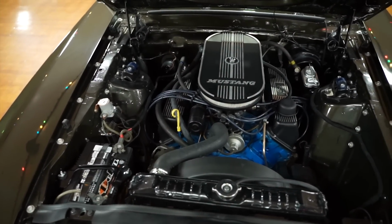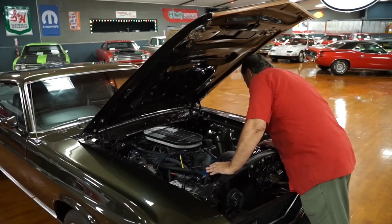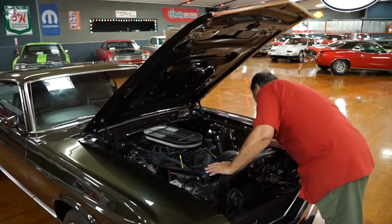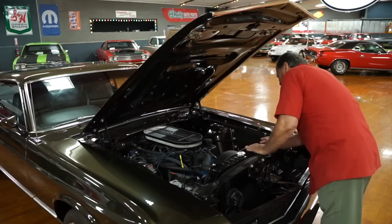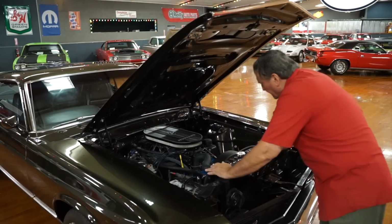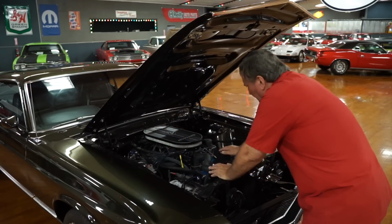The car has power steering, and it does have power disc brakes on it, a dual stage master cylinder in the front, a new alternator, new belts, and a standard cast iron intake manifold. It has, you can't see here, the original equipment cast iron exhaust manifolds, and there are no leaks evident whatsoever, at least not at this point. The top of the motor, valve pan covers, intake manifold, water pump, and front of the engine area all appear to be nice and sound yet.